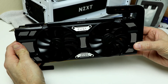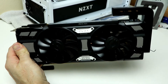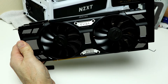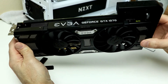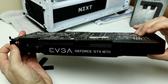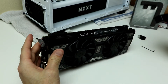We got the configuration correct — we left one 8-pin connector up top and took the other one out. But it still needs some adjusting, because there's a gap on the right side where it fits up snug against the video card. So we're going to go back in there with the tool, loosen up the little screw that holds the adapter, and slide the entire unit just a little more to close the gap, tighten it back up, and I think it will be a perfect fit.